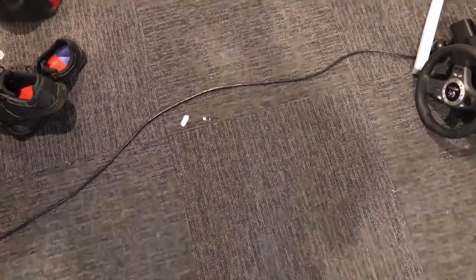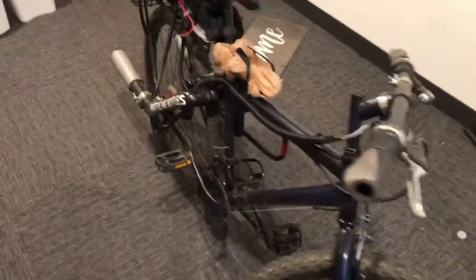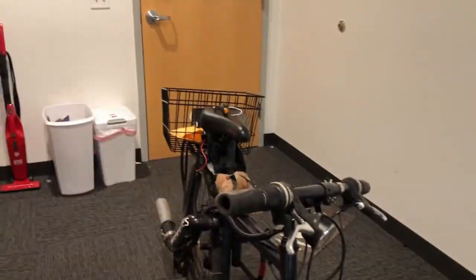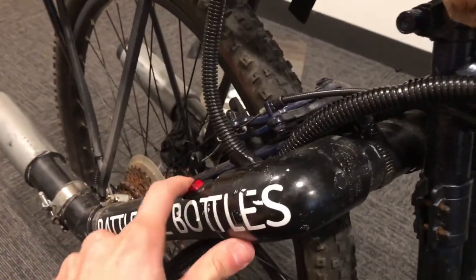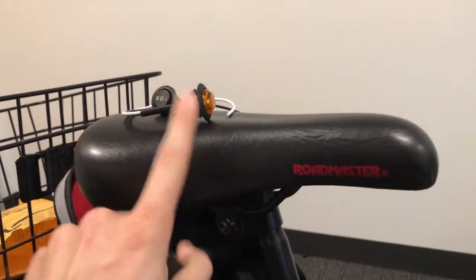Okay, so here's the plan. This is the midnight broom that I have been having up here on campus for the last 3 years that I've been here. And it has evolved with the years with the sound pipe and then recently a 12-volt head and tail light system, where the battery can run down from the little pouch here into the switch, toggling our lights. But now I want to add on to the circuit. So we got this blinker relay here with an adjustable blinking time in a sense. It's a little sensitive though for these LED lamps that I'll get here in just a minute.